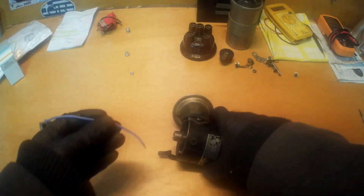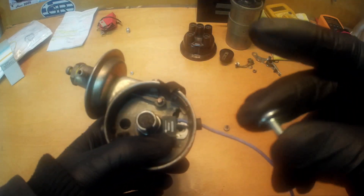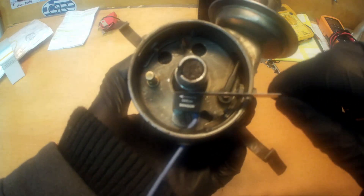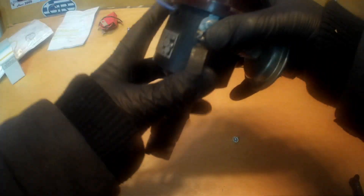Next, mount the 012CW sensor in the correct position. Insert the sensor carefully and do not apply excessive force on the wire to avoid cutting or breaking it. I will use the original screw to fix the sensor in the distributor, because the screw included in the kit is too tall and blocks the vacuum advance mechanism beneath the plate. Once the sensor is in position, adjust the gap between the sensor and the distributor cam tip to between 0.5 and 0.7 mm, then refit the rotor and verify that the shaft moves freely before mounting the distributor cap.